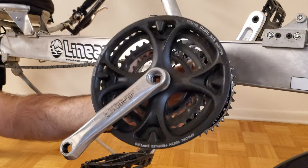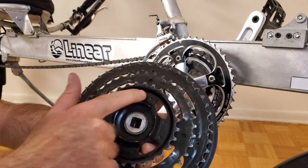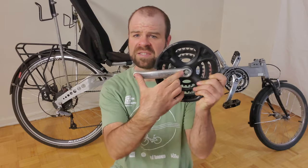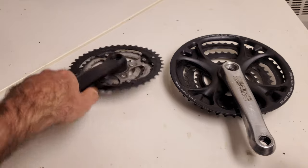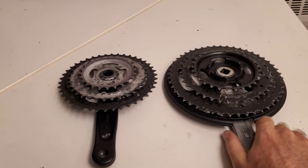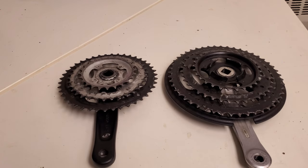I thought that maybe if I was able to gear the bike down even lower for climbing hills, this might help. The easiest way to do that is to change the smallest chainring to an even smaller one, but as you can see, the chainrings on this crank set are riveted in place and not designed to be swappable. I also read that other people who had experienced knee soreness when riding recumbent bikes were able to solve this problem by switching to cranks which were shorter. My existing cranks were 160 millimeters long, so I ordered cranks which are 152. These cranks also have smaller chainrings — the smallest chainring on my existing crank set was 28 teeth, where this one has 24 teeth. So when climbing a steep hill, I can gear down 14% lower to hopefully further reduce the strain on my knees.